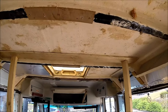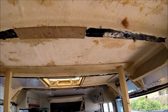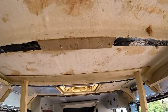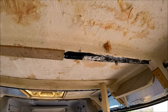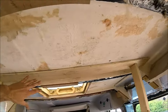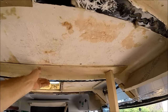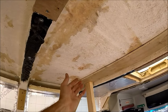So I'm just about to start drilling through for the brackets for the solar panels, and I've just cut down some 12mm strips just for internal bracing as well. Every single bolt that's going to be coming through will be going through the additional wood bracing inside as well. All that'll do is spread the entire load of the panels on the roof all the way across using the wood, rather than just on individual tiny little bolt holes, which might have slowly started to wear away